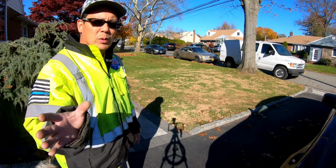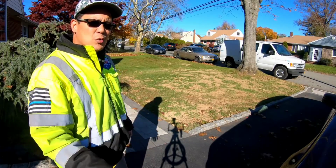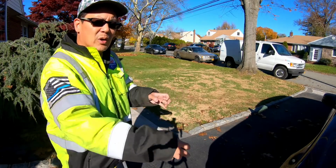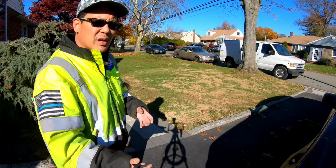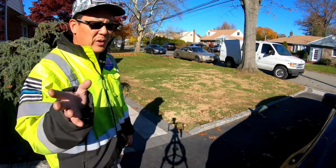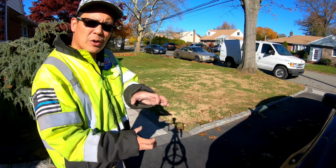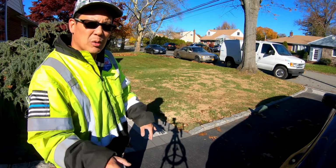So I went through the whole backyard and the front yard with that beige one. It had the starter hang up on it a few times. I'd take the cover off just to move the flywheel so it would not hang up. I need to fix that before next spring, you know? Maybe put some shims between the starter because I think it's too high or too low, one of those things.